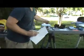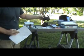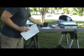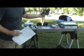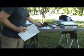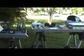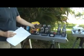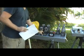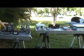Went to the dealer and got new motor mounts. We're replacing two of them, one on each side, and a transmission mount. And right there is about $110 or so of materials. And over here we got some rear brake pads, Posi Quiet ceramic. And right there is another $40. So you add that up and you're at $180, well under the $2,000.